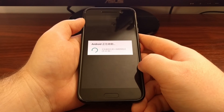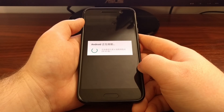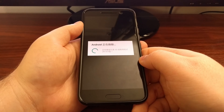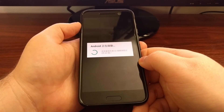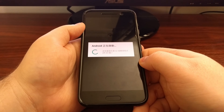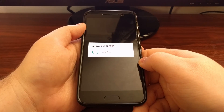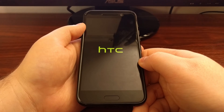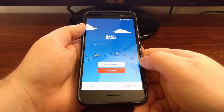This is the Android App Optimization screen. It's going to take about five, maybe ten minutes to complete, depending on how many apps you have pre-installed. We're getting close to booting into the Android activation screen. I just wanted to show you it will go from showing S-Off all the way to the Android activation screen so you know everything worked fine. And there we go — that is S-Off on the HTC 10.